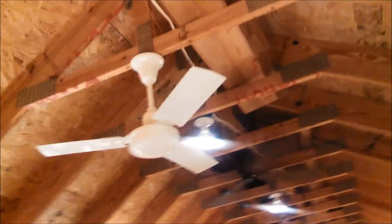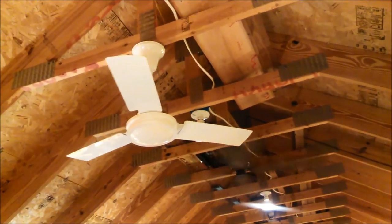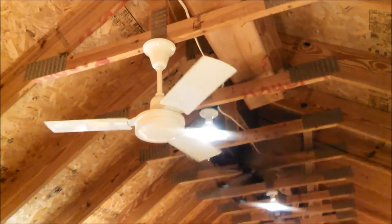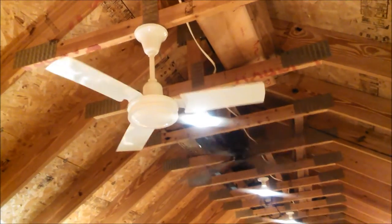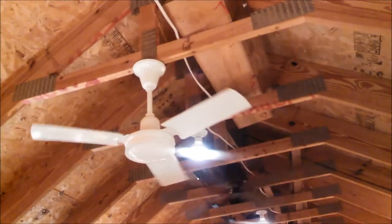Okay, I don't know if you can see. Fan, control, and that's with the 6 microfarad, and it's still, nope. I moved over here, and then it decided to finally start. Don't know what inspired it to change, but I guess we're still dealing with stiff bearings. 27.